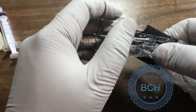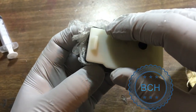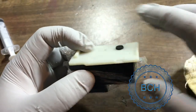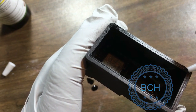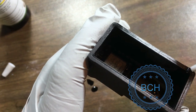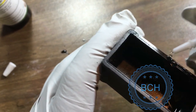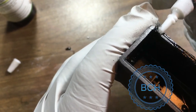Now we are ready to glue the top on the cartridge. Before applying glue, do some dry runs. The new cover's shape is a little different than Canon's original cover. Point the narrower side towards the top, which is the side with the electronic ribbon. Apply a layer of super glue evenly, making sure it covers the entire width of the wall. When the super glue is dry, it has to form an airtight bond.